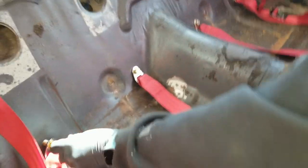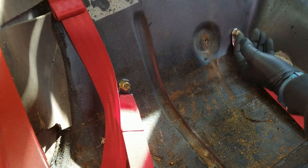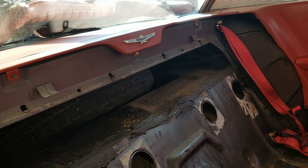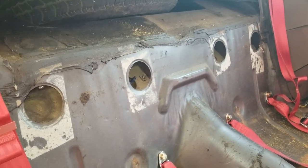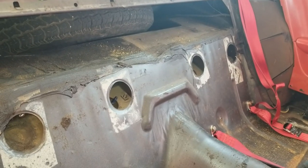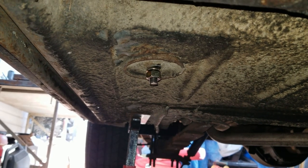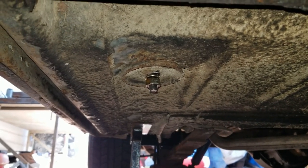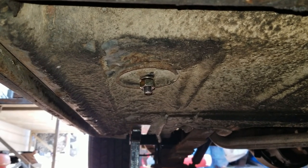Both places I have everything ready to go in. I'm going to need a second hand to bolt these down. For here and here, I do have the larger fender washers underneath for structural strength. Up here in the corners, these two that are installed into just some thin metal - the actual fender washer doesn't fit. It's nice to have the shoulder straps, the third point, but it really is just there for anyone that wants to feel a little extra safe. It doesn't add much as far as safety, I feel. We're laying directly underneath the front passenger seat, looking towards the rear of the car at the first plate, which is made for a seatbelt. You can see how big it is - it's like a big fender washer welded into the bottom of the car. I went ahead and placed a lock washer and nut underneath just to add extra security.